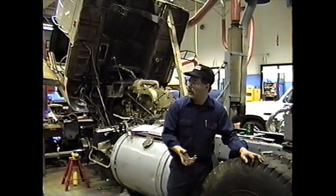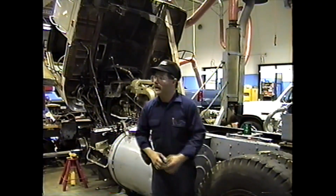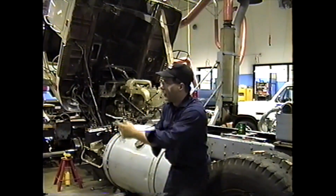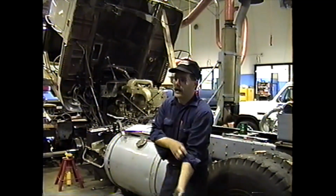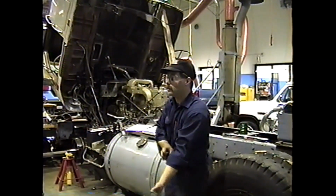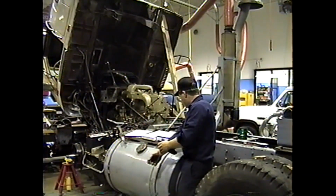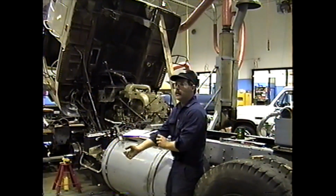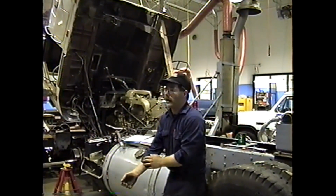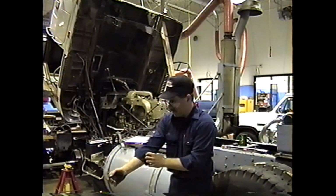We take our nuts and our wedges off. We take our outer, our spacer, and our inner. And then what's the last thing we do on the removal? Clean it all up and inspect for damage. What kind of damage are we looking for? Cracks and rust, holes, damaged threads. Okay. Then on the installation, what do we want to be careful of when we're putting our wheels on? You don't break the valve stem. On just the inner? Both of them, correct.